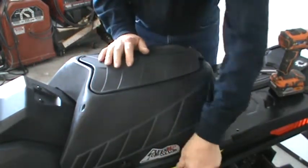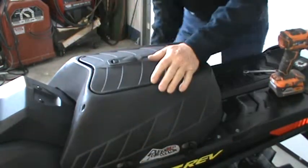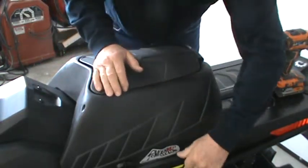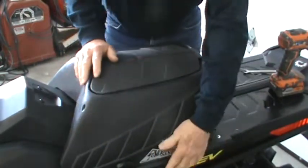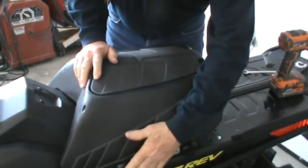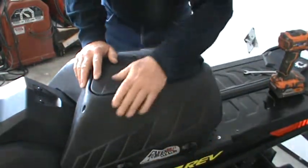It'll tell you in the instructions how to put these draw latches on the side of your box. It will also tell you that they work very hard at first. There's a short break-in period, just a matter of turning them maybe 8 or 10 times, to make them much more user-friendly. They're wearing off a little powder coating and getting the stainless steel items that are internal in these latches mated to fit each other properly.